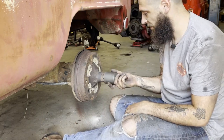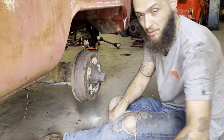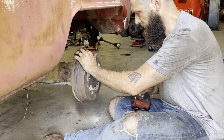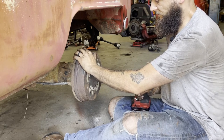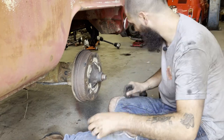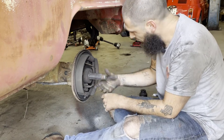Buses are weird because they've got a 46 millimeter axle nut back here, as opposed to Beetles and everything else. Might have something to do with how loose that axle nut is, but we'll see. Oh, that's not good. All right, so that might require some filing. Gacked those threads pretty good. Never done bearings back here before, but even in the shaft you can see there's quite a lot of play in there.